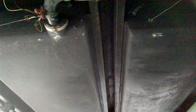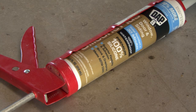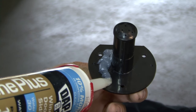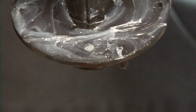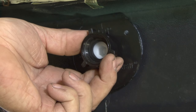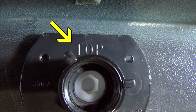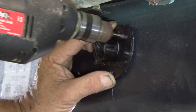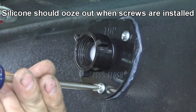On long narrow holding tanks, drill the hole in the end of the tank. Apply clear silicone only, completely covering the inside flange about three-sixteenths of an inch thick. Insert the No Fuss Flush in the hole, making sure the top stamped in the plastic is facing up. Drill one-eighth inch lead holes and fasten using the screws supplied.